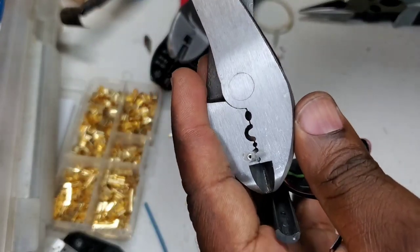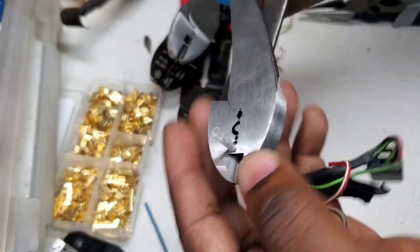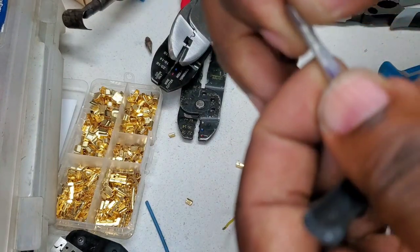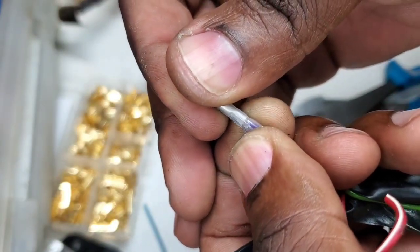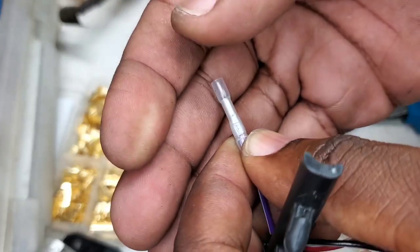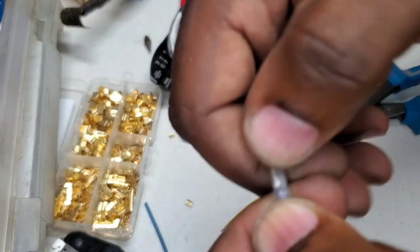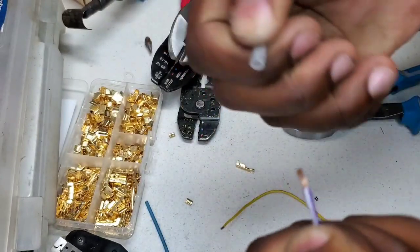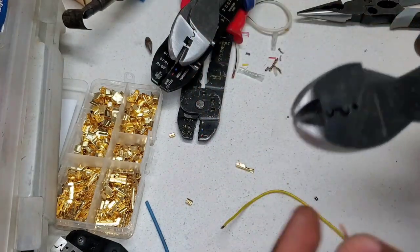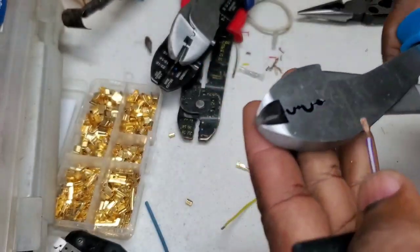This tool is not made for insulated connectors. Some people try to use tools like this on insulated connectors and damage the heat shrink. I actually do not see any damage on this heat shrink, but I was able to just pull right out — so that's a fail. This doesn't have any other teeth that are suitable or smaller, so this tool is going to be eliminated.